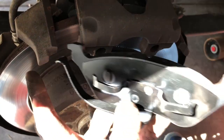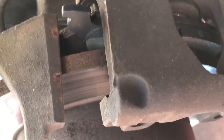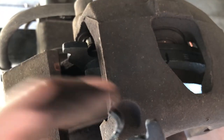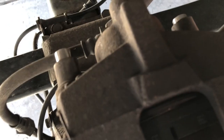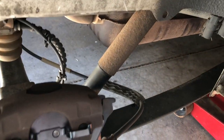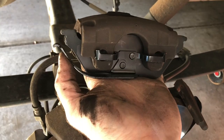Now for the other side — this little clip needs to go underneath this piece here. The other pads fit over the top. If you forgot what it looks like and didn't take a picture, you can see these little grooves with wear marks that show you where they go. This piece goes in there underneath — if it's sitting on top, you put it in wrong. Don't let your wife drive a van with bad brakes! The front brake is in — just use the palm of your hand to push it up in there with a little force.